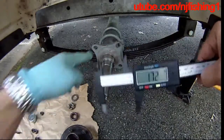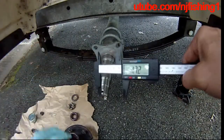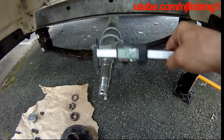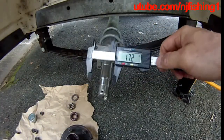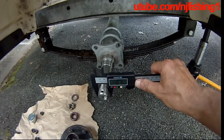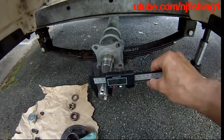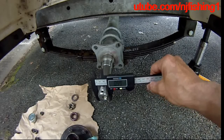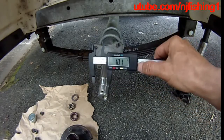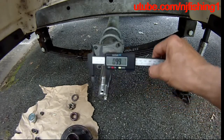This one is 1.71 to 1.72 inches, and that's the inner seal — it's gonna rest on this spindle. This is the correct 80/84 standard spindle, so I know my bearing is correct. And this one is showing 0.98 to 0.99 inches for the axle.